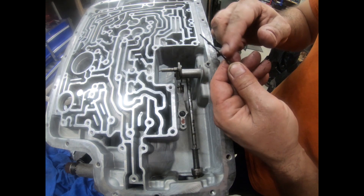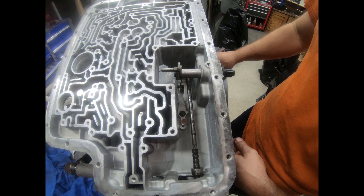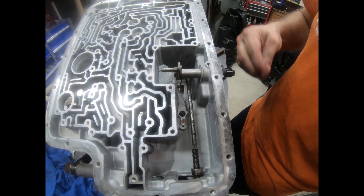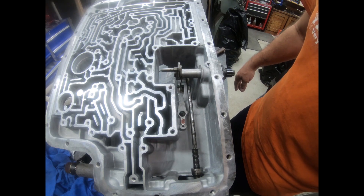Make sure you don't use cobalt or anything harder — if it cracks, it's going to get stuck in there and you won't be able to get another drill bit in. Just use something as mild as you can. I think this is high speed steel; that's about as hard as you want to go.